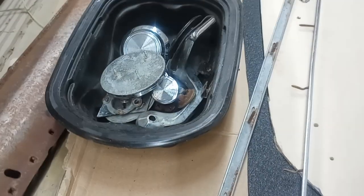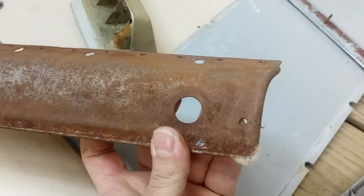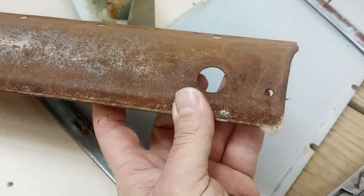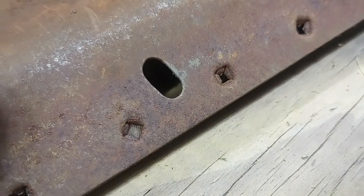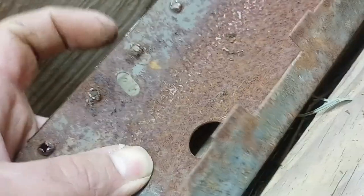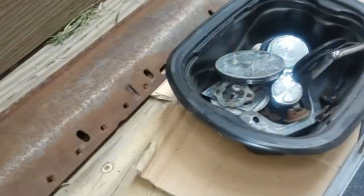The tricky part: this metal piece here is what goes over the top of the door right next to the window. This is where the lock popper comes through. Originally at the factory, these holes were punched through into the cardboard almost like a staple, where the spikes came through and bent inward, gripping the cardboard — it was on there really hard. So I straightened them all out. I think I'm going to use some short screws with T-nuts, attached through all these little holes. I tested it with a screw and it seemed to work.